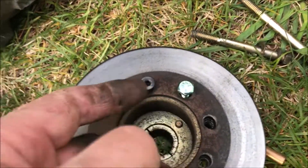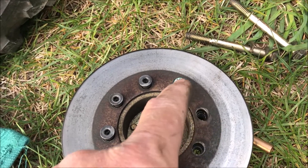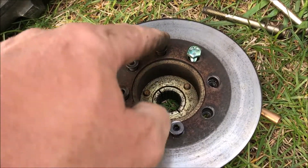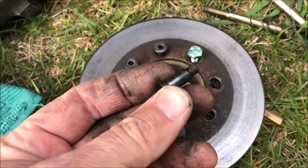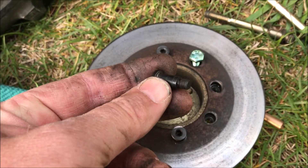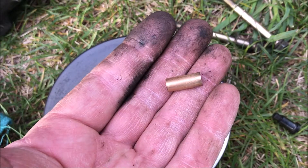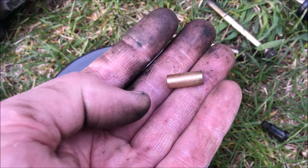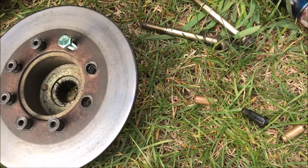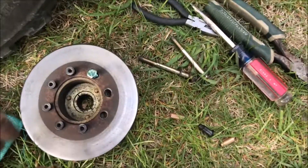These sleeves are a little long — I'm going to cut them off to half an inch because the shoulder on here is half an inch. My plan is to pull a couple of the existing bolts out so I don't have my replacement parts right next to each other — I'm going to have them across from each other instead. I'm going to remove each of the existing bolts and hit them with blue Loctite, since two of them fell out and I suspect the others are liable to fall out too. For $5 for two studs rather than $22 through eBay or $40 through Polaris, I should be able to get this machine back in order.